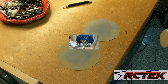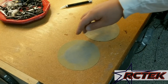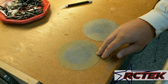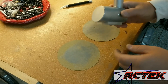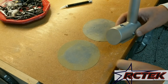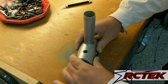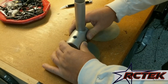What I have here is some 220 and 320 sandpaper with sticky back, stuck to my workbench. The key is to make sure you have it stuck to a flat surface — you never want to do this on a block in your hand. The 220 gets the nitty-gritty done quick, and the 320 polishes it up. Grasp it firmly, push it down nice and flat, do some circular grinding, then go at a 45, then again at an opposite 45.